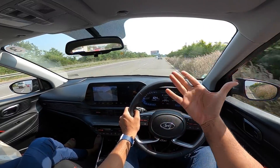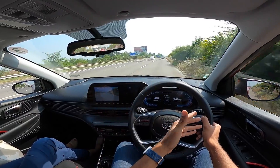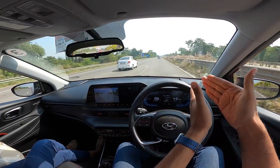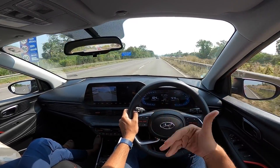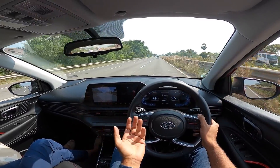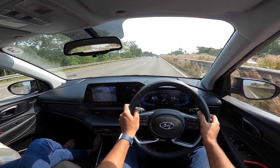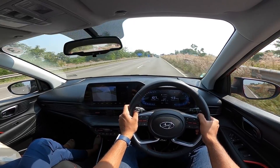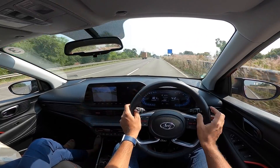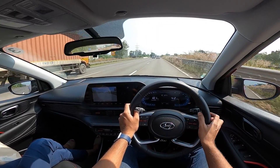The performance is very slick — it's quite a fast car. You can also get an IMT transmission, but a manual is better than an IMT for driving fun. The IMT does the job of an automatic to a certain extent since you go clutchless, but personally if you're getting the IMT, rather get the DCT. A manual would have made it half a second faster from 0-100 kmph. The DCT launches at only around 1800 rpm, so combined with the turbo lag the car doesn't take off very fast at the low end.